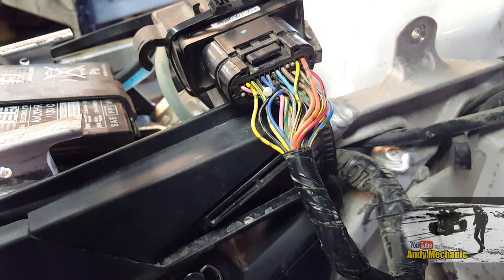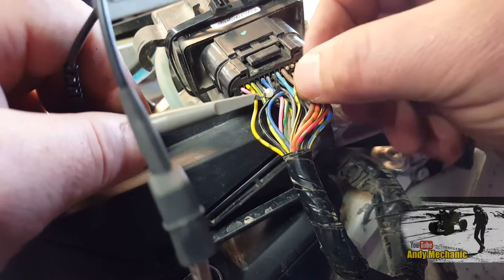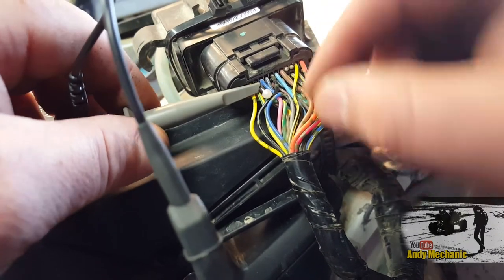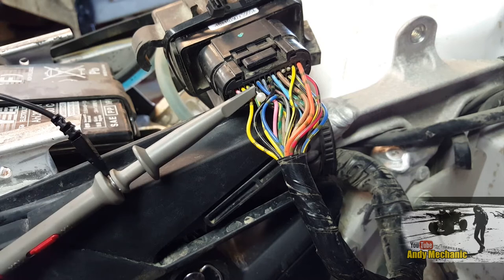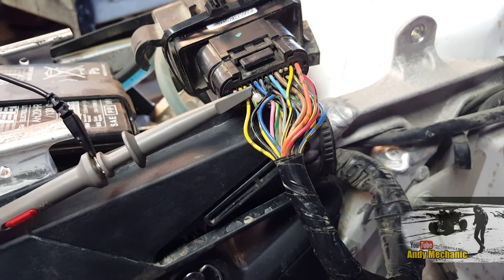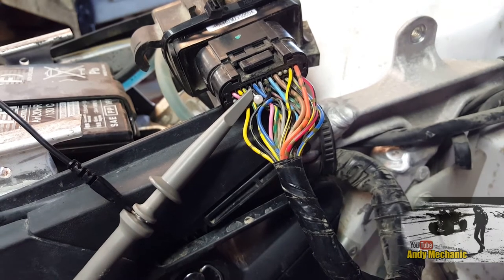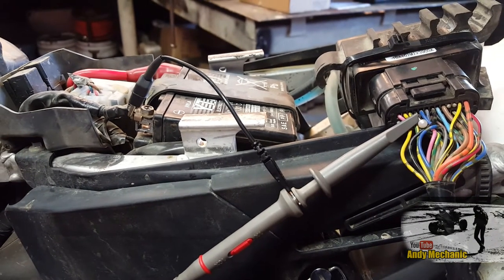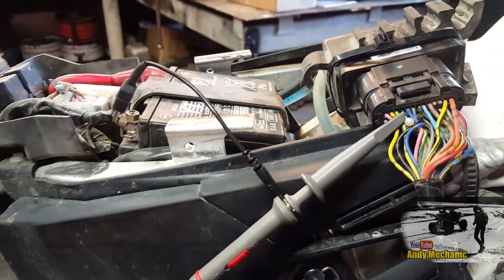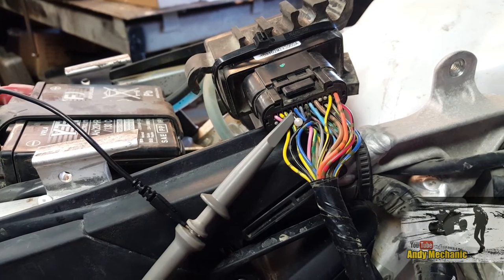All we need to do now is get our little probe and hook it onto the back probe pin. Make sure you don't get onto the bit of plastic at the end. Then we put our ground up onto the battery - battery negative would be a good idea. So we should all be set up now. You can see we're on the battery for the negative, and we're back probed into the grey wire with the black tracer on the ECU.